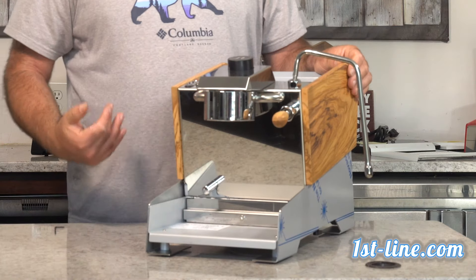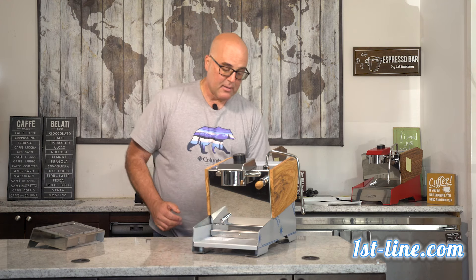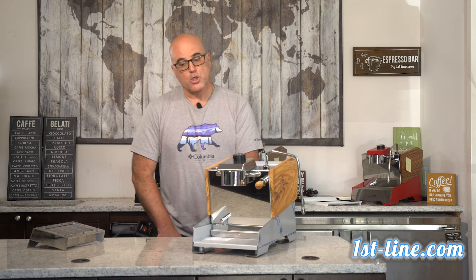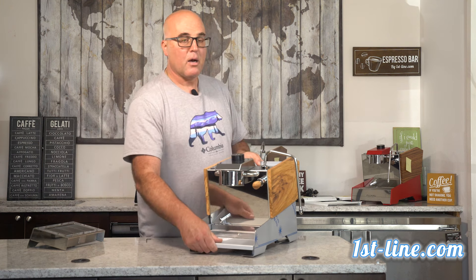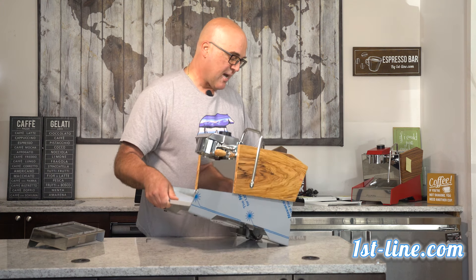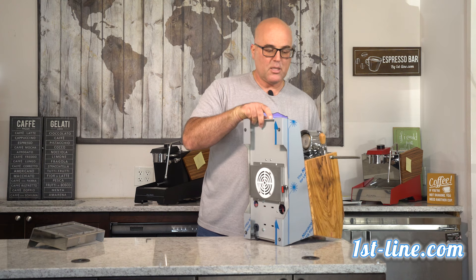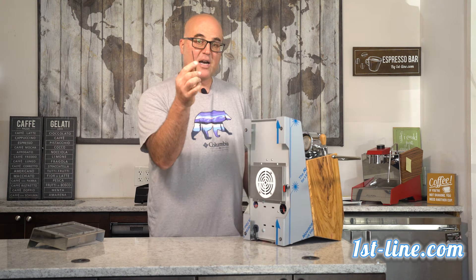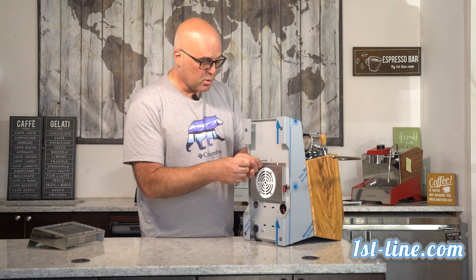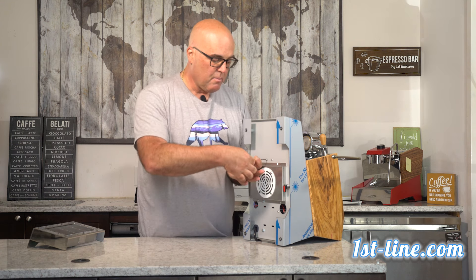To get that panel off, take out the water tank and unplug the machine — there's a power adapter. Then turn the machine on its back, preferably on a cloth or a clean surface. Once the machine is on its backside it becomes fairly simple: use a 2.5mm metric allen key and take out the two middle screws.